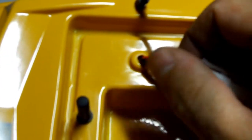Also when you cut it, you're going to cut roughly where the switch is. So the best thing to do is undo your screws and pop your switch through, because you're not going to be able to get your knife blade through there. If you want to keep it brushed, be careful you don't cut these wires off — you will need them. If you're going to go brushless, it doesn't really matter as those wires are too thin anyway. So we're just going to cut it out now and I'll show you what it looks like after.